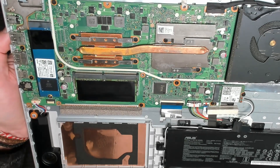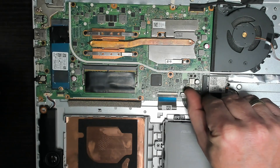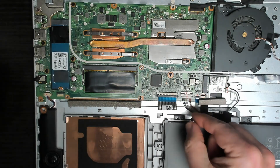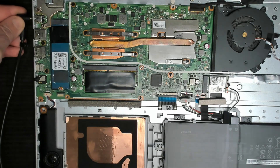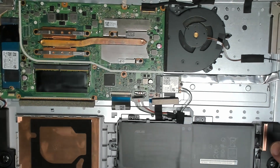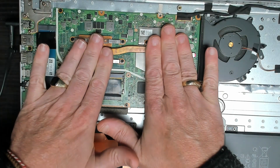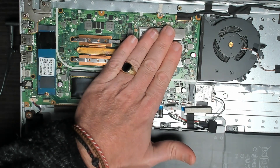Let's start with the obvious — disconnect the battery. There's no BIOS CMOS battery on this laptop, so disconnecting the main battery should reset the CMOS. There's a silver clasp that needs to be pushed in that direction and then lifted. Plugging the laptop back in, the power meter is pulling 15 watts, the charge light and power light come on, and the CPU is warming up.